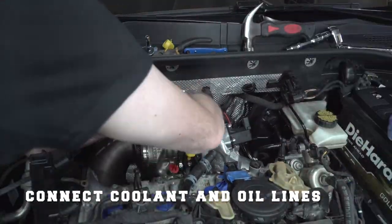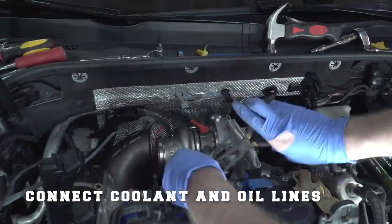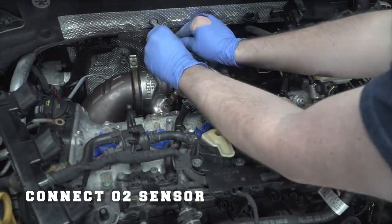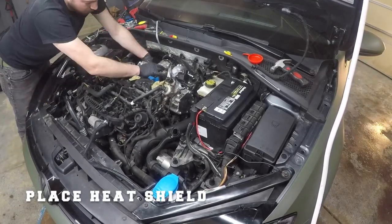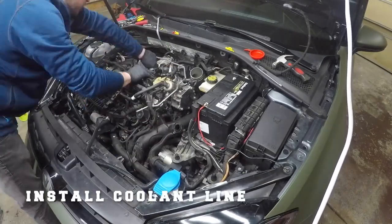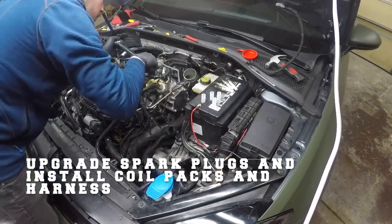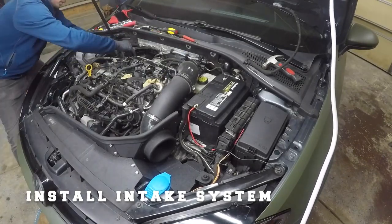Now just like all installs, it's a matter of working backwards. For us it made sense to connect the oil line underneath the turbo first, since that gave us so much trouble at the beginning, and then work around the turbo connecting all the coolant and oil lines. Leave the top oil line last because you need to prime the turbo with some engine oil — you do not want it spinning without oil when you start the car. Now get the heat shield back in place, install the PCV valve and turbo inlet pipe, reinstall the coolant line over the engine bay, and replace the spark plugs with plugs that are a step colder, as suggested with the Unitronic tune when running the IS38.